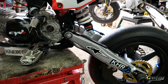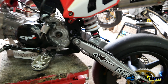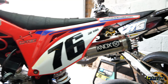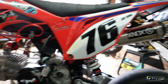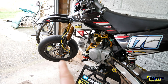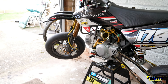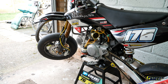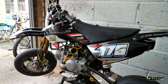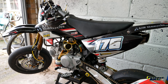She's pretty much ready to go. We'll get these final bits on — I'm going to clean the carb out before I put it back on, put the correct gearing on for Ella tomorrow. It'll be a 16-39 — it is a 16-40 for Ella, but it's 16-39 for Spain, and we're not going to be going quick tomorrow so I'm not worried about being one tooth out. Also, the M2R over there is going to have a play tomorrow, because I did say in an earlier video that we need to check if those wheels are going to help that horrible bobbing — where it's just vibrating down the straight. So we'll see if that's fixed. That's got R's on it, so they're going to be good tyres for the nice cold January weather tomorrow.